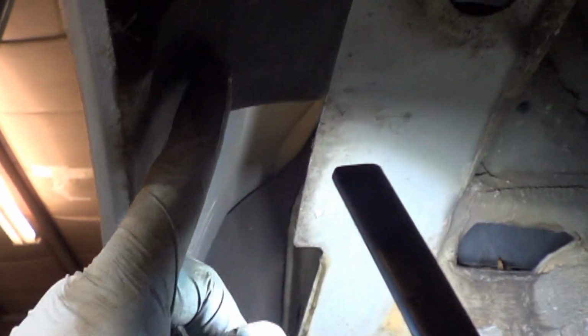Okay, I believe this is a 2012, but it's of that generation, even if it's not exactly a 2012. It's a common rail TDI, and we're doing a timing belt job on it right now. And I just wanted to show that Volkswagen never learns. They put these foam things on Mark IVs, and they cause the fenders to rust. Literally right there. And they're still putting a piece of foam there.